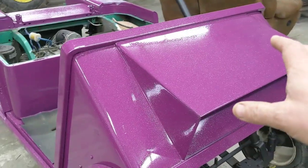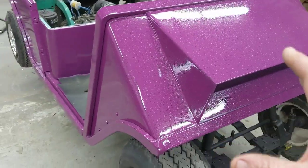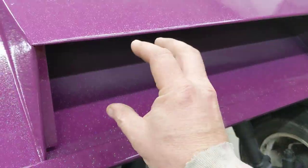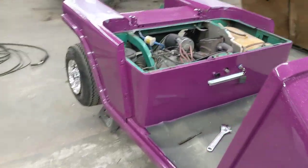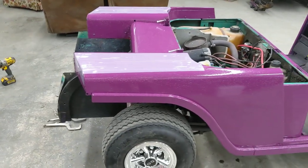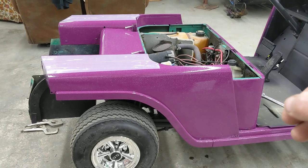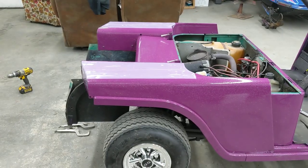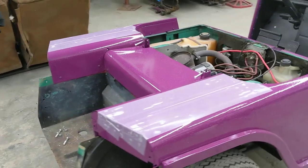This is kind of my hood. Some people thought it was a hood scoop, but I'm actually trying to replicate a little bit of a Jeep look. Inside right here, I'm going to end up putting a stainless panel with two headlights mounted in there, and that's how I'll have my headlights for at night. Somebody suggested mounting a backup light onto the wire I disconnected from my reverse switch that would have triggered the backup alarm, so I'll be wiring a backup light on the back via that wire — great idea from the person that commented on that.